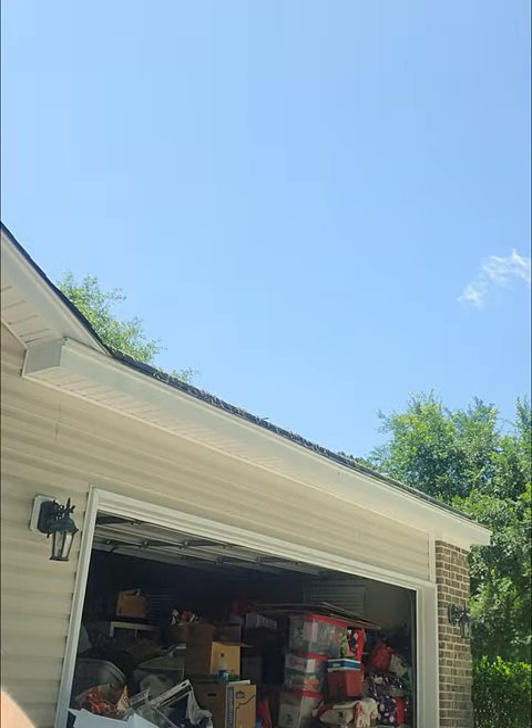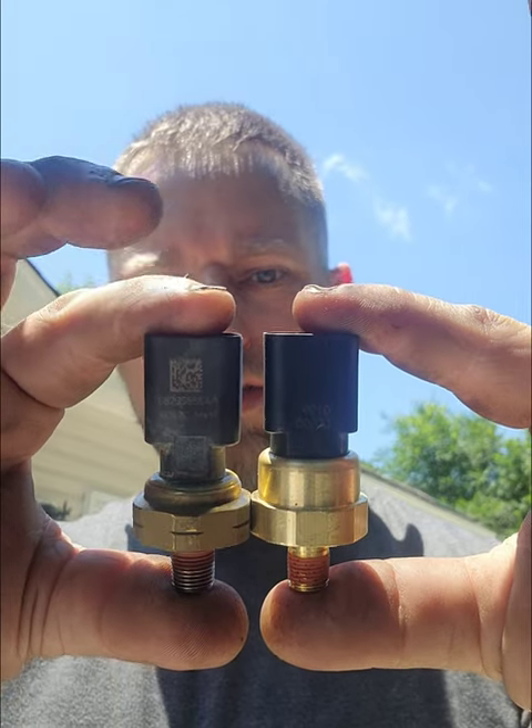The replacement sensor is PS674, a Standard brand from O'Reilly's. The original part number is 68295556AA, and below that it says 6047C with a space MX14. They look to be the same depth inside — it's just the physical inside shape is different. Side by side, there's a little bit of difference, but overall same length and connectors look the same except on the inside.